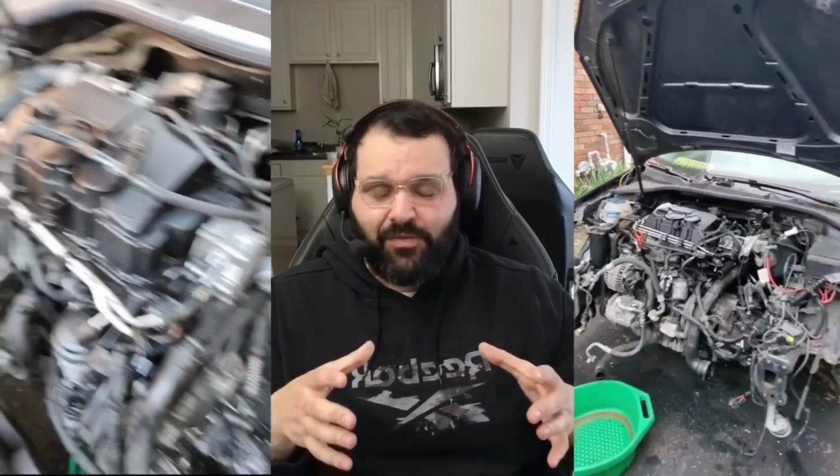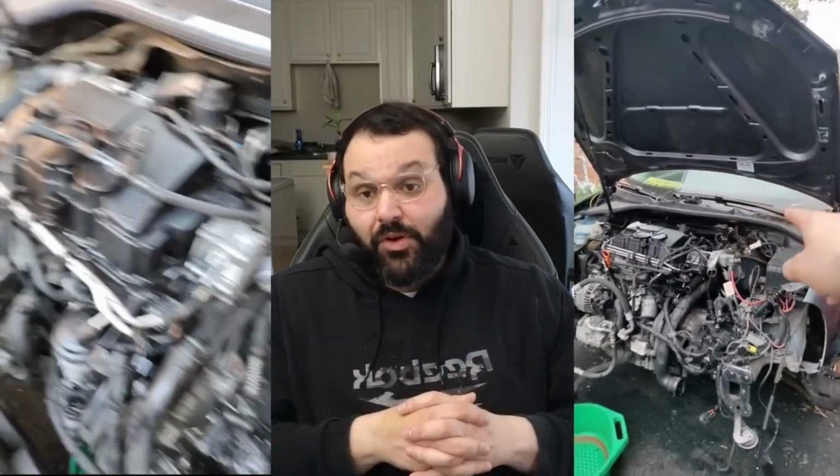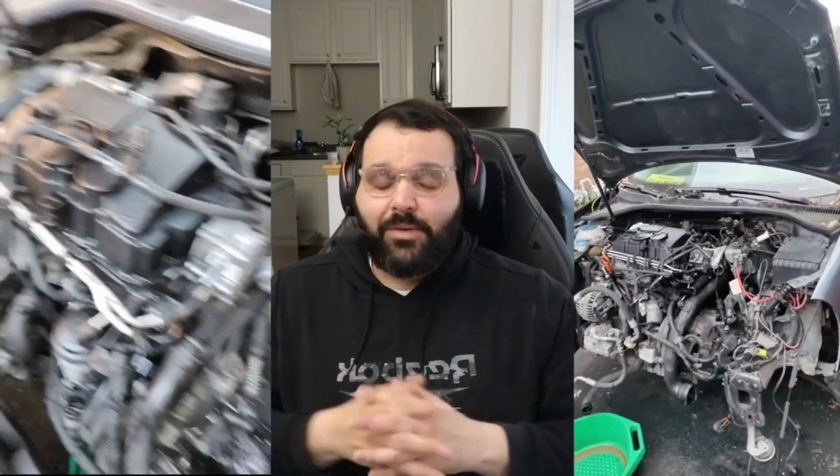So that's just another tip for anyone who's trying to do this for the first time, or who is working on softer ground. Even works if you're on soil. Just give yourself a better platform. Put the jack on it. The jack won't sink into the soil, or at least won't sink into the soil that much. Kind of like snowshoes, right?